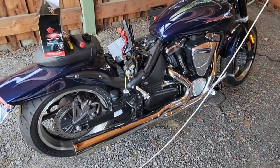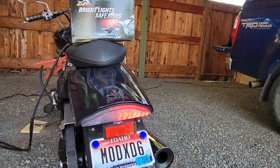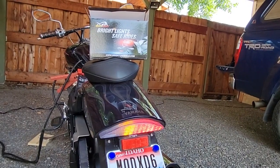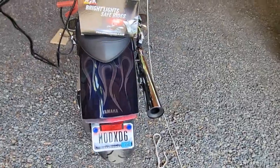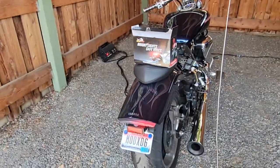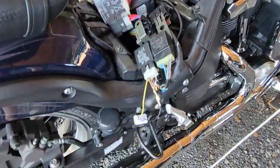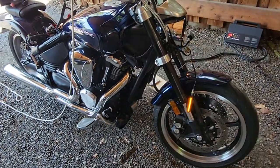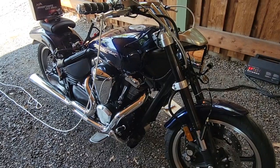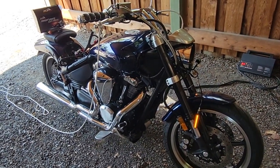The Bright Two Wheels unit seems to be working fine. But if you get that, you're either gonna have hyper flash or you're gonna have your front turn signals just stuck on until you upgrade the front turn signals too. Hopefully you get some better quality ones than what I'm working with right now. Good luck out there.